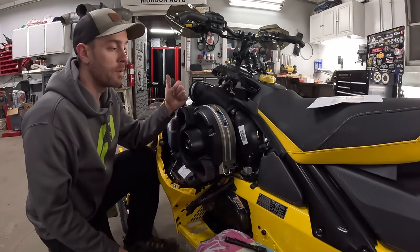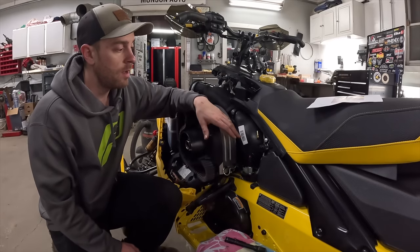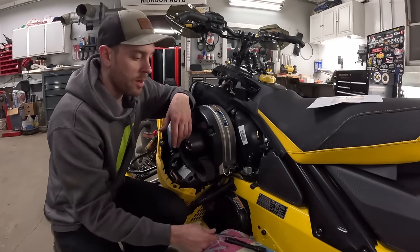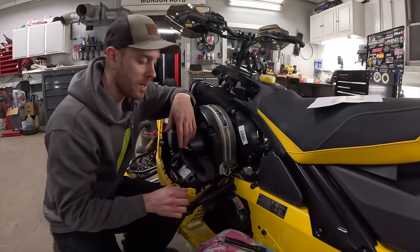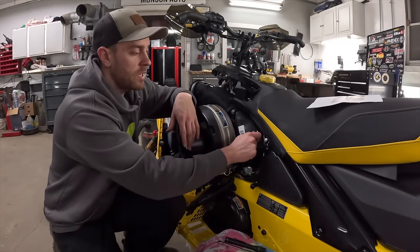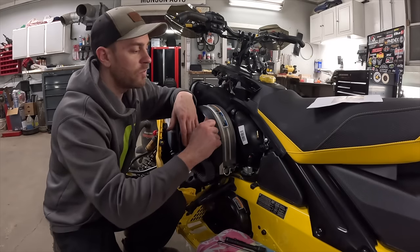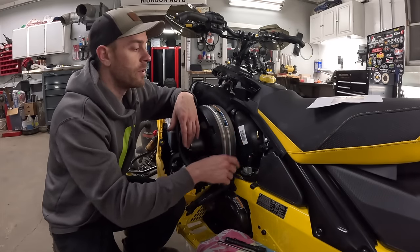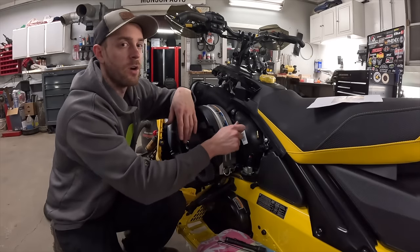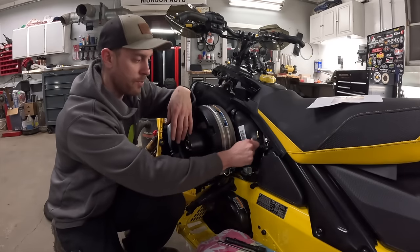One more thing before we move up front to the pipe sensor, I wanna talk about tightening this fitting. Obviously, you don't wanna over-tighten it and strip the box out. What I ended up doing, as you saw, was spin it, tighten it. The wrench was a little bit too long and awkward, so I used the smooth jaw little Knipex pliers there and rotated it around. I thought it was pretty tight, it took moderate effort. And then I test it by seeing if I can move it by hand. I was able to get it to start to rotate a little bit. It wasn't like I could just continue to spin it. It took some effort, but it did move a little bit. I was confident to just do one more full rotation from there, and now it's in there pretty good. I'm not pushing as hard as I can, I'm not trying to Hulk on this thing and rip it out of there. I can't get it to move now. It's in there pretty damn good.